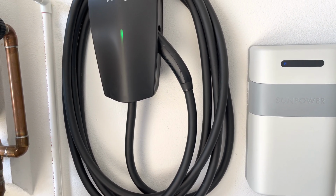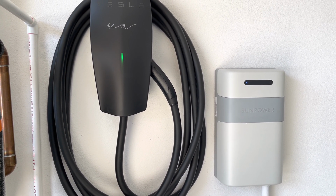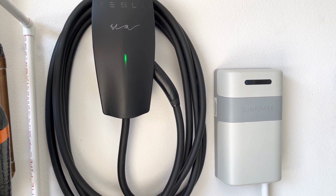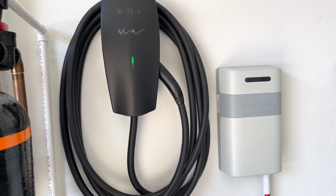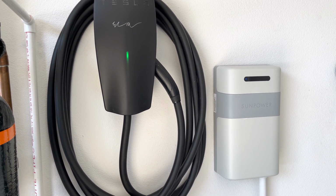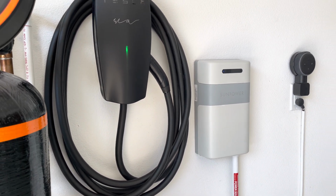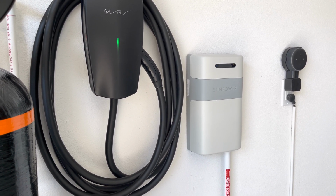With the Cybertruck and the Roadster coming out, we're thinking that it might have a 150 to 200 kilowatt-hour battery to give it that 500 plus mile range. That might be a problem because you won't be able to top off your charge if you're close to empty overnight. You're gonna need maybe 14 to 16 hours on a 48 amp. But with the 80 amp, if Tesla does bring back the 72, 80 amp capability for the vehicle to charge up to that speed, you can top off just overnight, 6 to 8 hours. And of course, people would like to slow charge to preserve the battery, but you can control that within the vehicle. You can lower the amperage on your display. So that's not gonna be an issue.